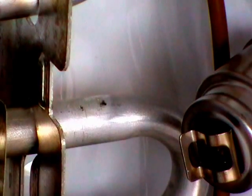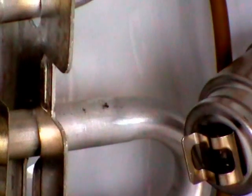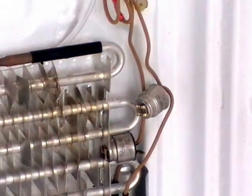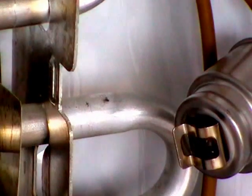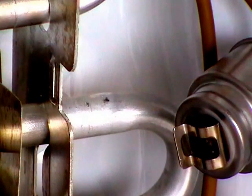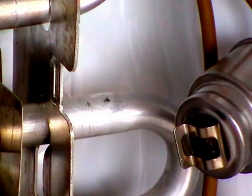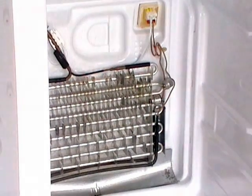So if you've got an RS-H1 where it can be re-gassed and it works for a short while and then it stops working, this thermal trip needs moving to see if you've got a hole in the pipe there. It can be repaired — it's not the end of the machine. But if you've got this hole in the refrigeration tube it's usually beyond a DIY repair. The absolute repair would be replacing the whole evaporator and that is definitely a systems engineer's job. It'll cost you a few quid but it's a repair that is possible.